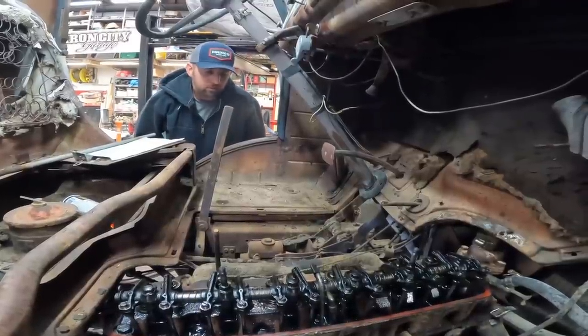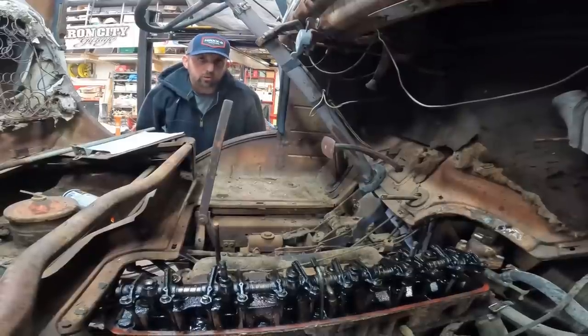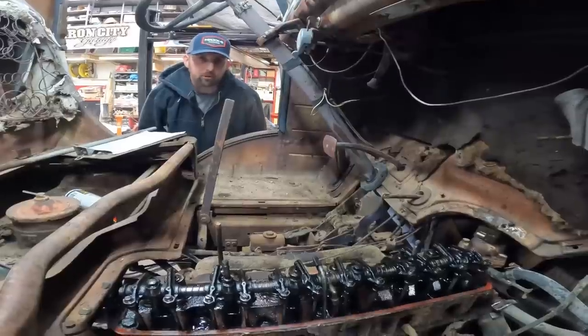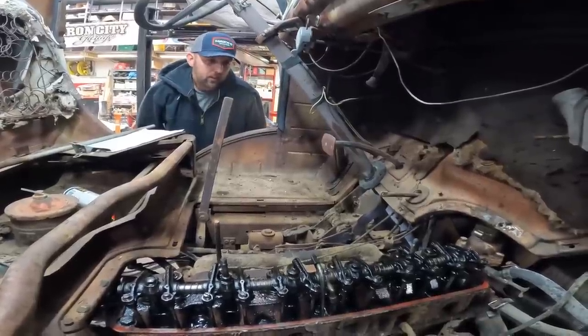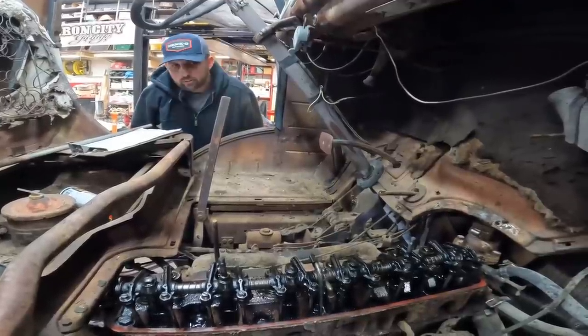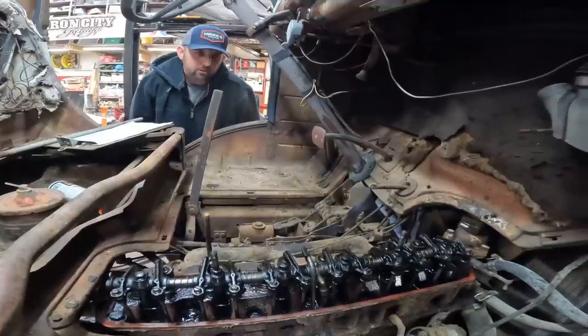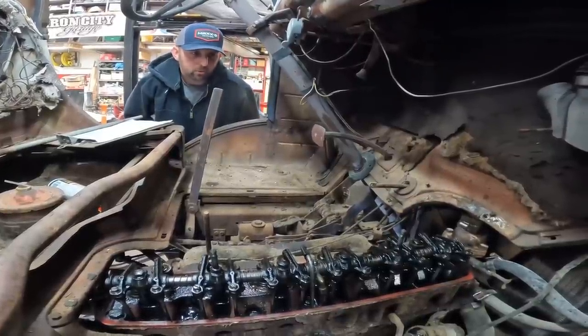Business back then was no different than today, in the way of, you get busy and it's still running. It just runs a little rough. You just keep it pushing to get the job done. So it wouldn't take that long to kill a cylinder with a bad misfire. So who knows? Just start running through the steps. The only thing that causes low compression here is a cylinder issue, piston issue, or valve issue. It's simple. So we'll just start rolling stuff out.